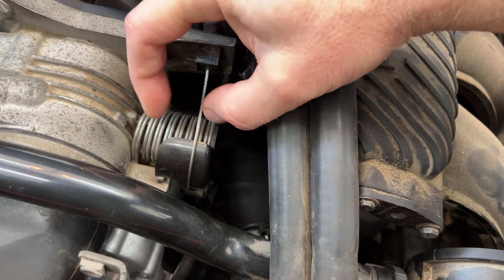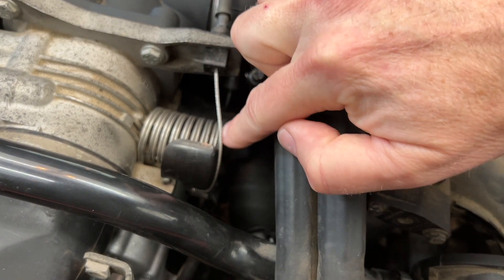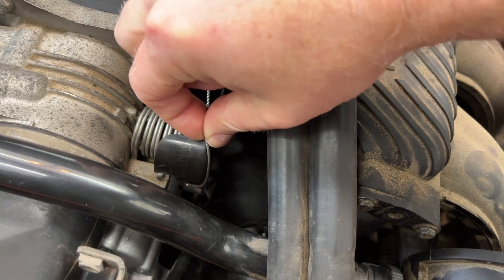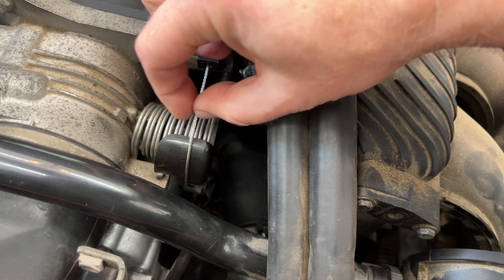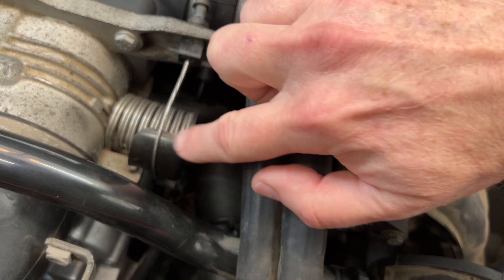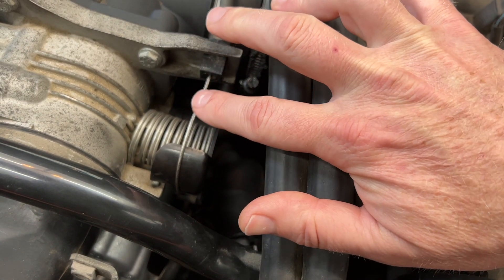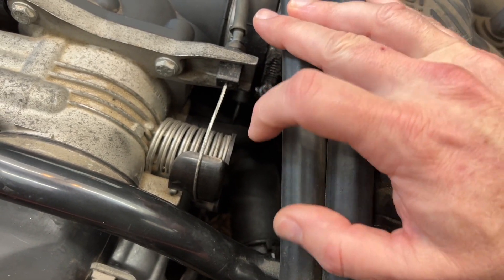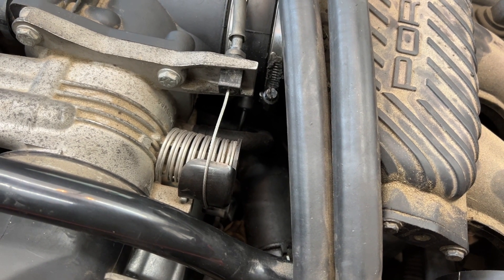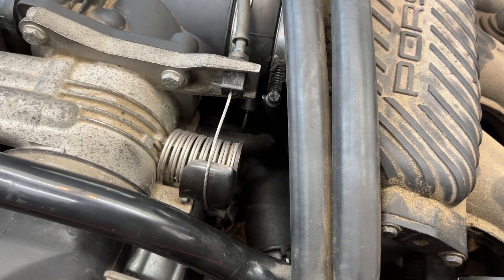My cable still has a lot of play here, and it slipped off, so when I pressed the accelerator I had to press it all the way to the floor to grab this and lift it up some. I'm not sure if it's supposed to be this loose — maybe I stretched it out somehow. I placed it back and pressed the accelerator pedal several times with the car off to test it, and it didn't come off, so definitely press your pedal after putting this on to make sure that it is on.